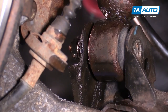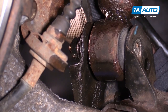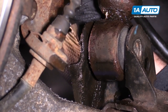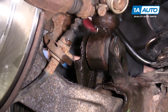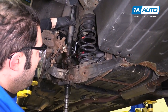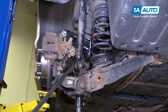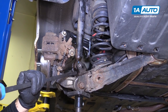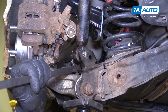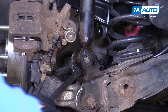Got a slot wide enough now. I'm going to take a small pry bar and wedge it in there, and a ball-peen hammer and try to tap it away and break it off. There it is. The shock is loose, but part of the bolt is still through the opening on the other side. I'm going to take a pry bar and try to wedge this out. I'm not worried about bending this stamped steel on the control arm too much, because when I put the bolt back through we can pull it back together. I just want to get it apart enough to get the shock out. There it is.